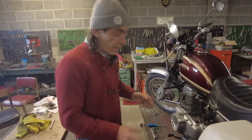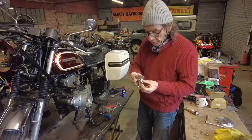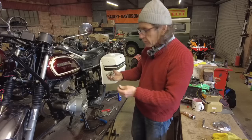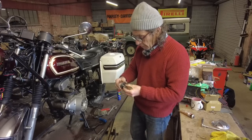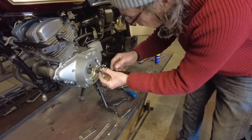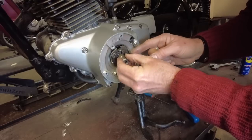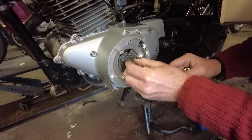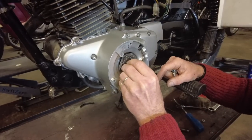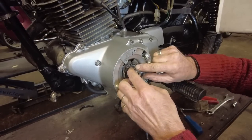That's that one done - I love the look of that case; it's been scabby for years. The next job is to put all the timing stuff back on and check the timing. The next thing to go on is the advance mechanism, which we took apart in a very early video when I first got it and couldn't get it to run right. This is okay now. It has a locating peg that has to go in a slot on the crankshaft - this could be a little bit fiddly. You've got to locate that in the right place and make sure it seats snugly. Just rotate this until you get it in correctly - it'll just slot in flat. There we go, that's located with the peg in the ring.